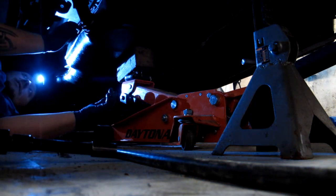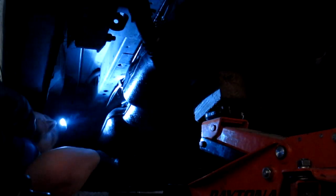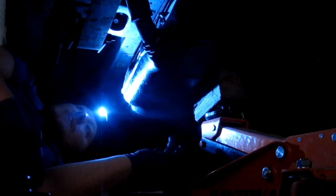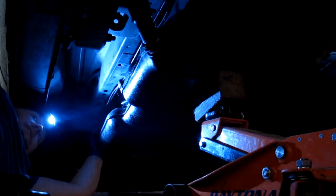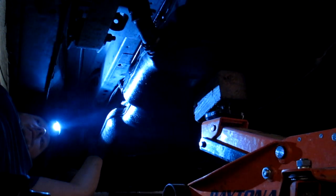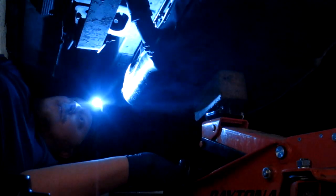The brake line literally runs next to the gas tank, and it's rusted as hell. Is that the hard line you're holding? Yeah — follow this line up to that box right there. It might be kind of hard because you're going to lose it. I found the line — it's this big curly one. It's good. We're going to have to take it off at the ABS pump and figure out where it goes from there.